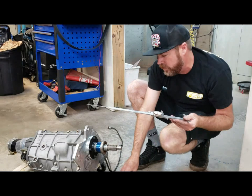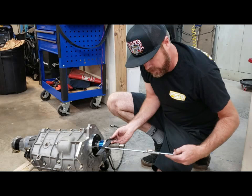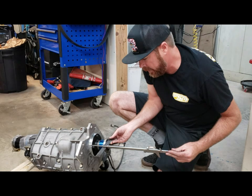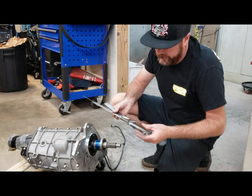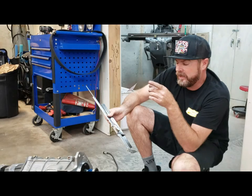We're going to put our straight edge against the face of the bearing, just like we did over there, and then measure from the bearing to where the bell housing bolts. Subtracting the thickness of the ruler, this is 3 inches 145 thousandths, which means if we had 3 inches 195 thousandths there, we've only got about 50 thousandths of an inch air gap here.